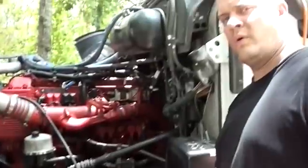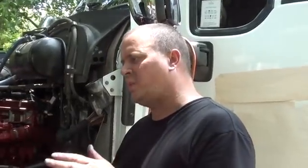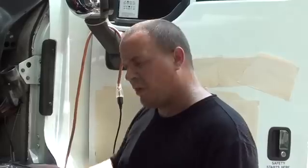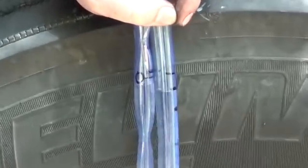It might get a little loud but what we're going to show is that at an increase in RPM, the fluid level will rise. At idle — around 690–700 RPM — it'll be at a set distance, but as we increase to 1,500 RPM you'll see a greater separation on my truck. I'll go ahead and ruin the ending on the good truck: there is no separation — whether it idles or runs at 1,500 RPM, the levels stay just about the same.